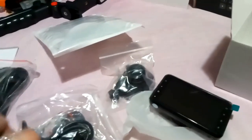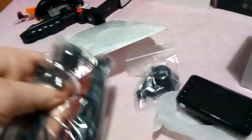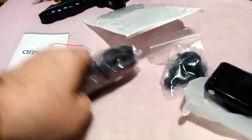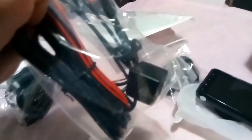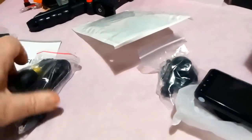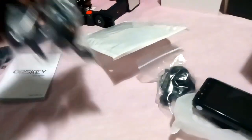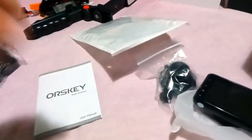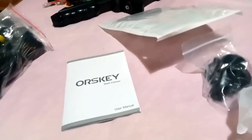Okay, so now I've read the book and I know what I'm doing. Well, that's the theory. So that definitely is the back stuff. That's the camera and the leads. When the red lead goes to your reversing light, so you can use it as a reversing camera. That is definitely just a charger thing. Now it's got batteries in it, but the batteries are only good for three to five minutes, which is so that when you switch the thing off - or I guess if you're in an accident where the power gets disconnected - it'll record for three to five minutes before it stops.